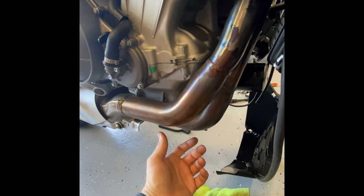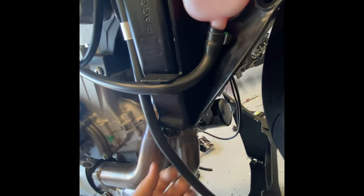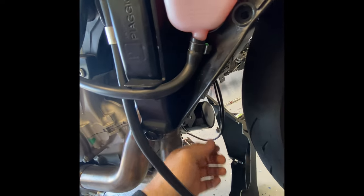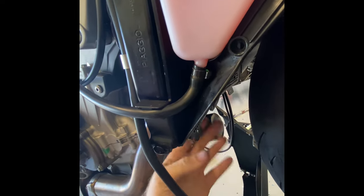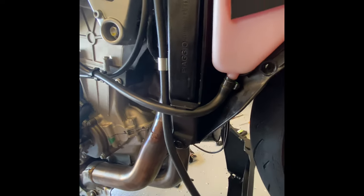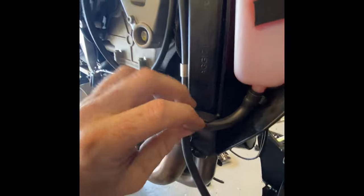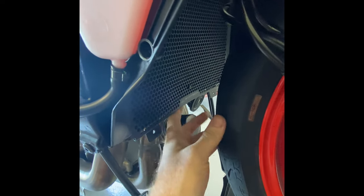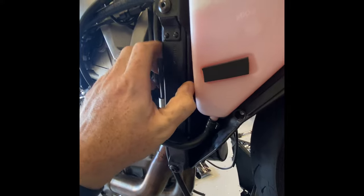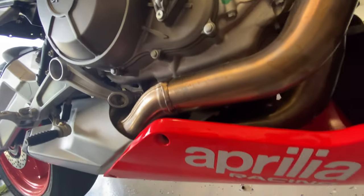You want to make sure that hose goes back into the hole in the middle of the bottom cowl. I'm going to try to put this back together. As far as putting the bottom piece on — maybe it's a fitting thing where it'll stay in place better with the weight on. Between the rubber and the two bolts on each side putting pressure on the thing, it's not going anywhere. It's pretty solid. What I find works easiest is to start with the bottom left bolt, then this bolt, push this to where it's aligned for the next bolt, and do the same on both sides.